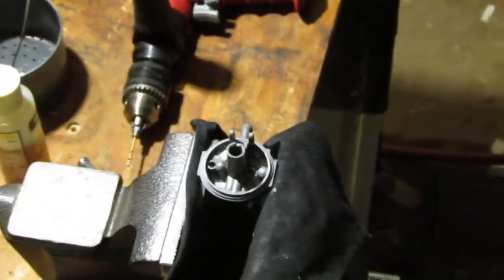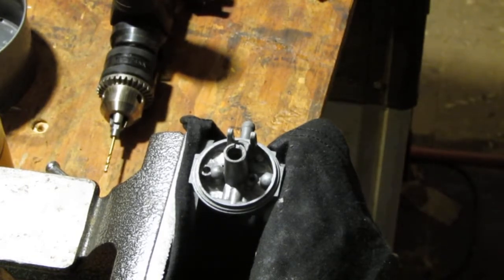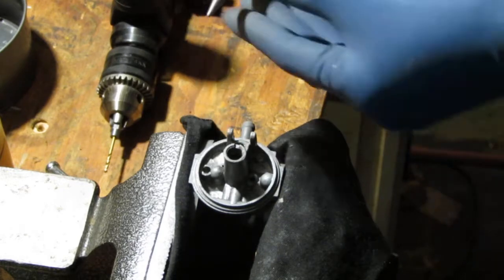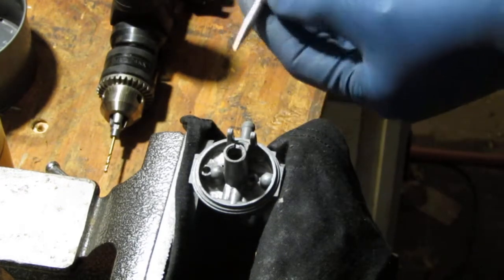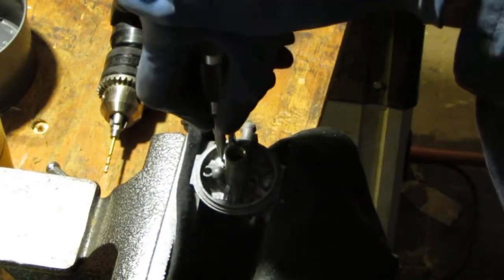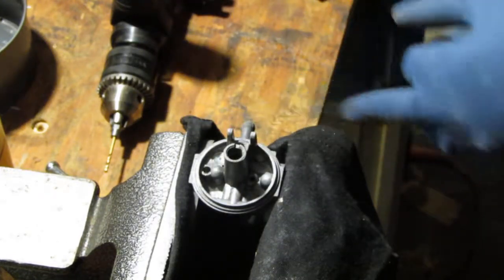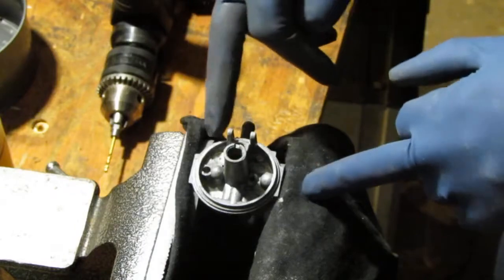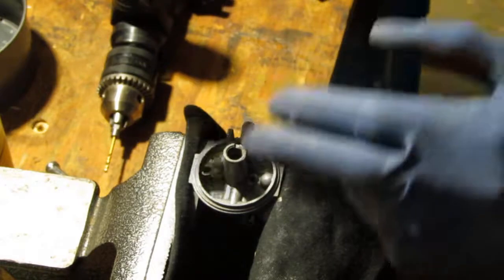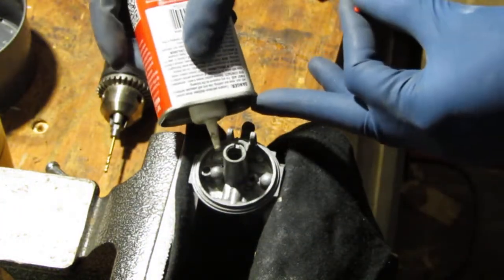Make sure you can still see. Okay, great. This Welsh plug is right here. The first thing I want to do is get a starter hole going, in the center. One should be enough. It's soft aluminum. That's going to be a lot easier to do than freehanding it.